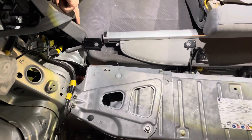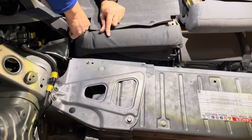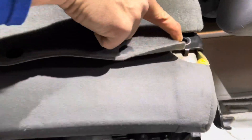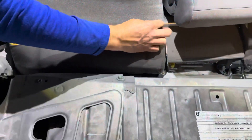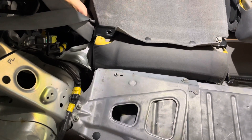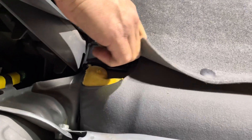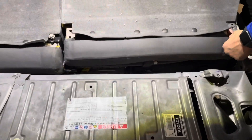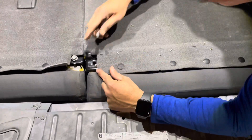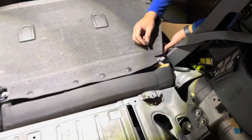Make sure your seat belt's out of the way. Go ahead and slide your seat into place and run these mounting brackets over the top. You'll see how they fit — there's a little notch here, and the mounting bolt goes into the threads. It also helps to lift up on them and get them started. Do not cross-thread these; they are infamous for cross-threading. Just make sure you get them in there properly. Using your 14-millimeter socket, go ahead and tighten these down.